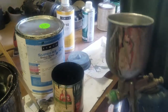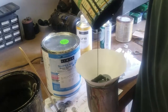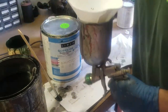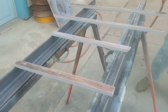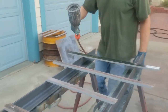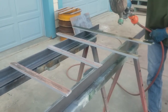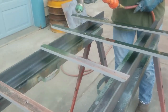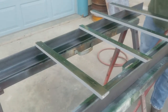Right here we're getting ready to put it in the gun — I'm straining it again, and the gun was obviously cleaned between the primer surfacer and the color coat. Color takes more shots than primer surfacer — primer surfacer you can do in one round, but color takes three rounds to get it up to what we want. For the initial round I put the parts on top of sawhorses on angle irons and work on the underside, really focused on that rounded edge. Obviously additional paint gets on the rest of it, but the edge is what we're after.